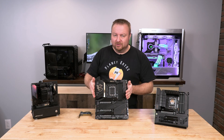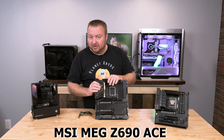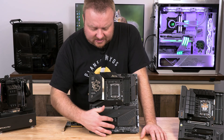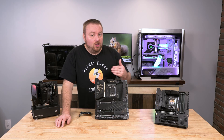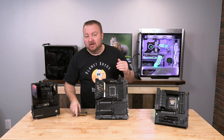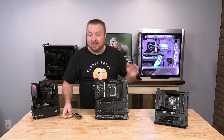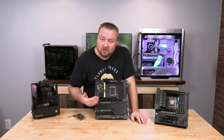Here I have an MSI motherboard — a top-tier, fairly expensive board. What we have here is three PCIe slots, and they're not all equal. They're all x16 slots physically, but that doesn't mean they all run at x16. This card runs at x4, so you cannot run anything lower than that. There is also a x1 slot, which is very short and this card won't even physically fit in there.